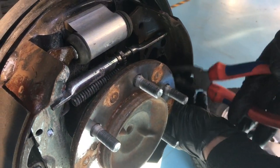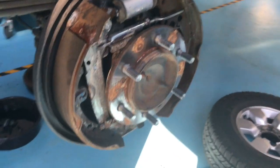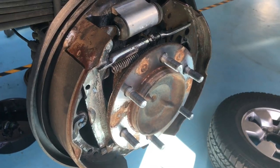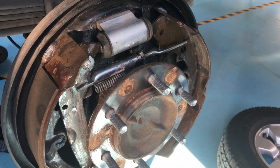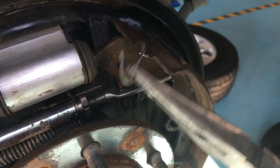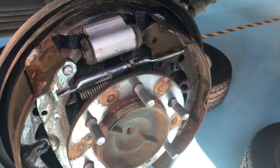Slow and gently does it — there's the clip and the pin at the back. Always lay it down nice and in order, left and right exactly how it comes off. That way you don't have to think. With drum brakes every vehicle's different. The ones without handbrake in the drum were simpler — just shoes. This one can sometimes fly on you, so be careful — any of these clips can go flying.